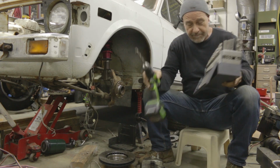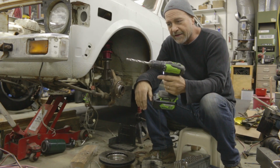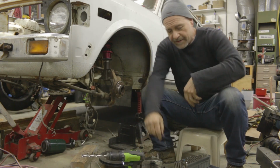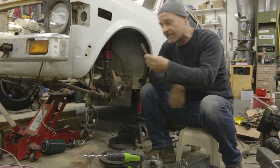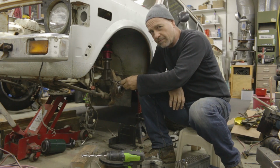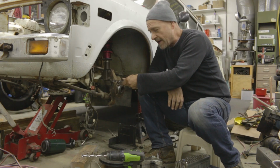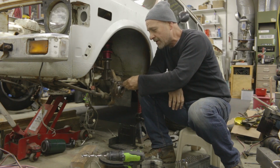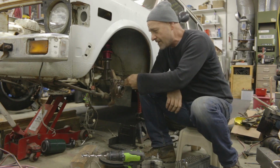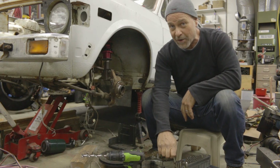And I just used a standard cheapy lithium battery drill, set on kind of a low, high torque setting. And I essentially just started going up in 64th sizes. Because when you're enlarging holes like this, going up a tiny bit each time helps keep the axial placement of the drill more true, and it doesn't break bits if you get into a big piece of meat. A 64th is very, very thin.